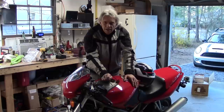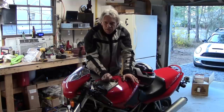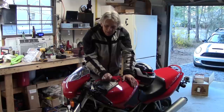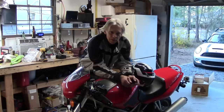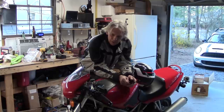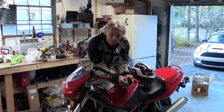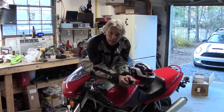The front brakes are really easy to modulate — they stop really well. The thing handles great, it turns into corners like I could just think about it. Very nice handling, kind of reminds me of what the BMW was like, only it feels 300 pounds lighter, even though it's only about 130 or 40 pounds lighter. Stock this weighs about 510 or 520; the BMW weighed 630, so it was pretty heavy and very top heavy. It's fun, it just feels great out there. The thump from those two cylinders is phenomenal, and the torque when you roll it on — you better be hanging on. It's all torque all the way through the range from the low end on up. I've looked at the chain — it's a little bit sloppy, I need to crank that up; it's probably closer to 40mm when it's supposed to have around 30 some odd millimeters. But the chain looks good and everything seems to be working great.